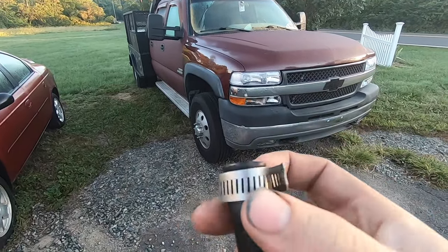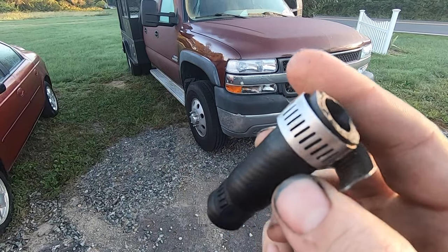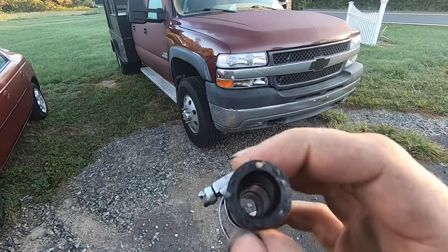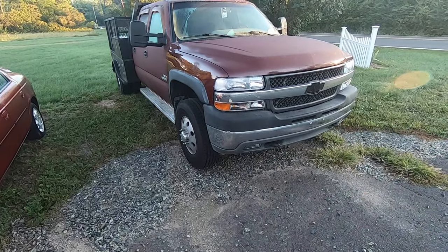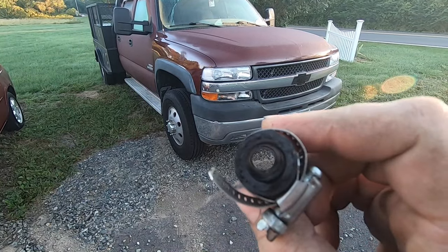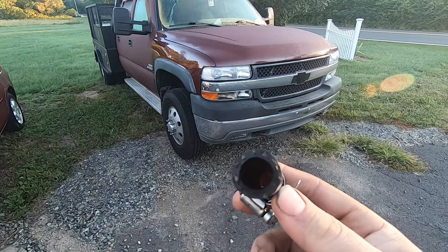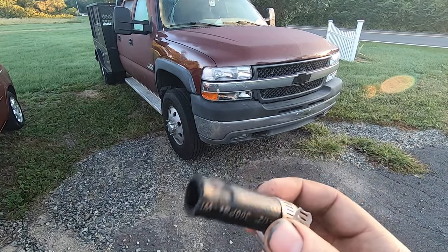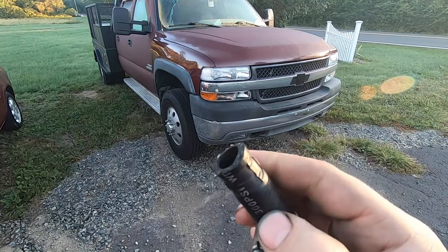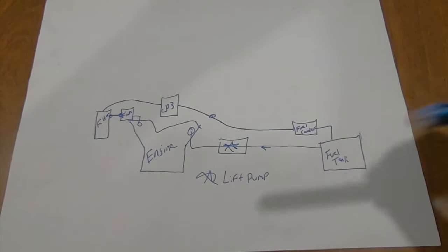So that's it folks — just one little piece of hose like this can park one of these trucks or give you a whole mess of headaches. This is a very easy one to fix and easy one to find. There are going to be times when it's trickier, but this fuel system has to be absolutely airtight. It's probably one of the bigger problems with these trucks — small air leaks can cause so many problems. Anyway, thanks for watching Spank Ranch Garage. If you've got a problem with your truck, put it in the comments and I'll help you fix it.